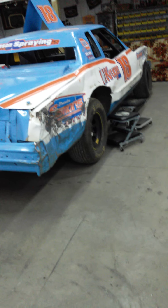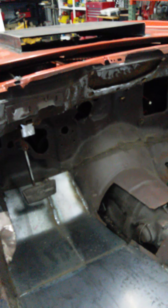With that other car it already had the roll cage, the doors on, and the roof on, so we had to climb in and out of the car to put the floor in. Luckily on this one the doors are off, the roof's off, and the old part of the roll cage is just a small piece — so it's way easier to put stuff in. That's kind of the advantage to this one. Still gotta put on all of our thin aluminum and rivet it on to cover all the holes.